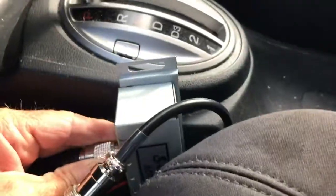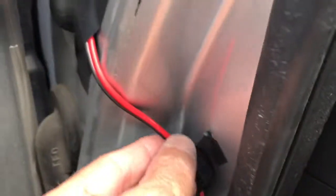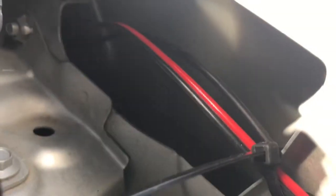What I ended up doing was installing the box — which can actually come out, I just have it stuck down in there. I brought the wire here and then up and under the dash, going along here, and brought it through the door — which isn't the best — and then into the fender well, which is not sealed completely but is pretty weatherized. Let me open the hood and I'll show you real quick. I just brought it right through the fender there, down, around, and hooked it to the battery terminal and then to the ground wire.